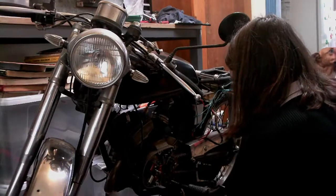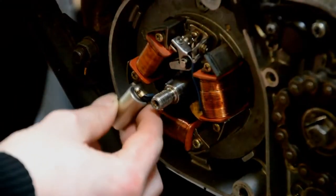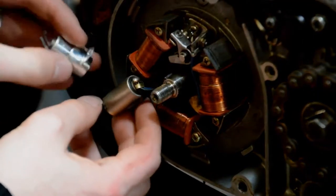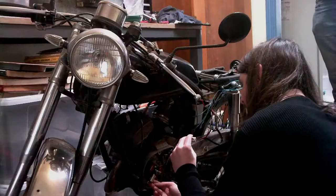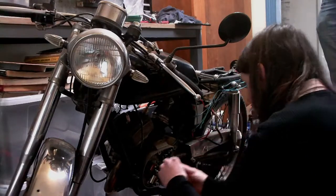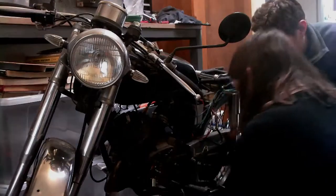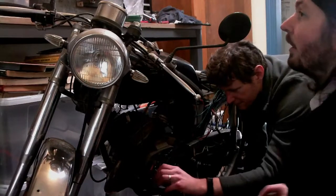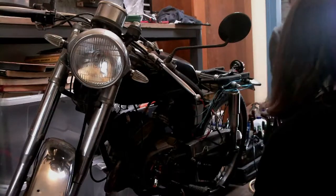We've just relocated inside because it was getting a bit windy out there and we wanted to do a bit of soldering — best to be out of the weather. Making sure they are exactly the same thing — yeah, I don't think there's any real doubt. Those two tabs: I thought they were soldering tabs but actually they're clips that go around the wires, so if we loosen these off and unwrap the tabs first, we should be able to attach the new condenser.